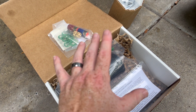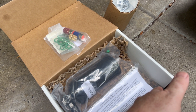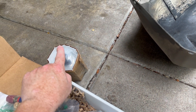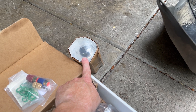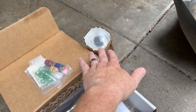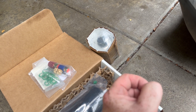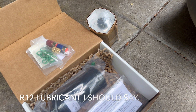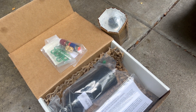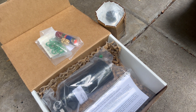But aside from that, just a really good evacuation. It's already had the R12 removed, but we're going to pull vacuum on it a bit more. And this is actually ester oil that comes with it. You'll notice you have either PAG oil or ester oil. The advantage of using ester oil in this particular conversion from R12 is that chemically it combines better with any residual R12 that might be left in the system, rather than the PAG stuff which can turn to a gel and start clogging things — and you don't want that. So that's the ester oil; we'll be putting that lubricant in when we recharge with 134a.